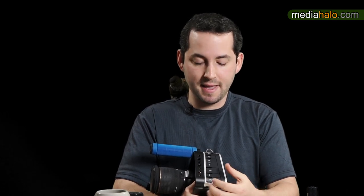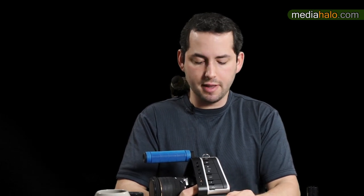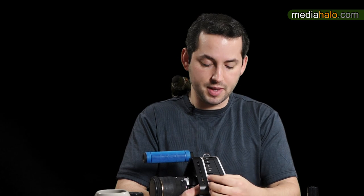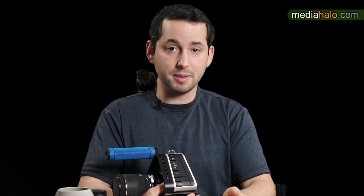What's even odder is that it has Thunderbolt, which is also used for display purposes, and there's a dongle that adapts Thunderbolt right to HDMI with no extra power needed. But for some reason they didn't build the circuitry for it — Thunderbolt is mainly limited to UltraScopes. You can use the SDI port and convert to HDMI, which isn't terribly expensive and works pretty well, but you still need to find your own power solution and mount it.